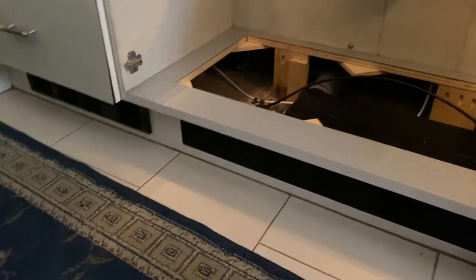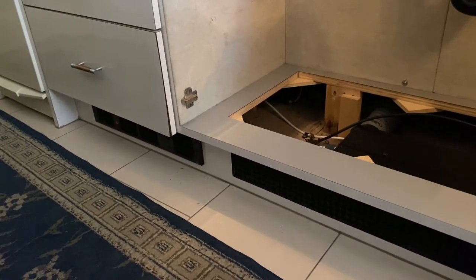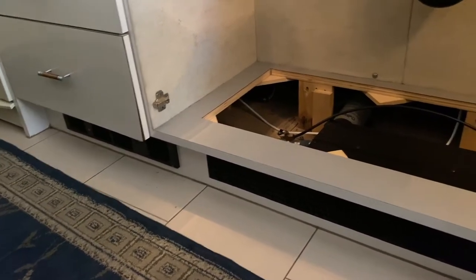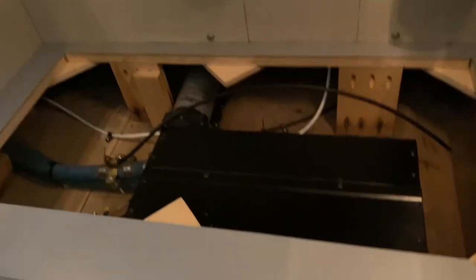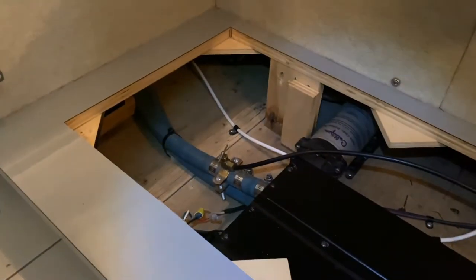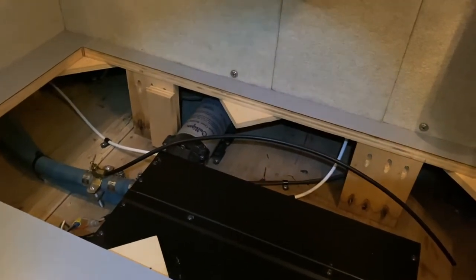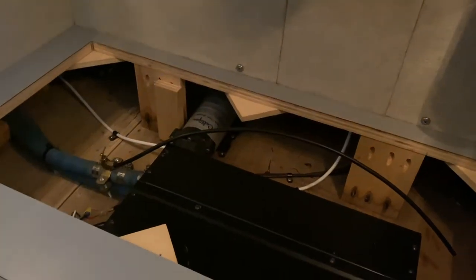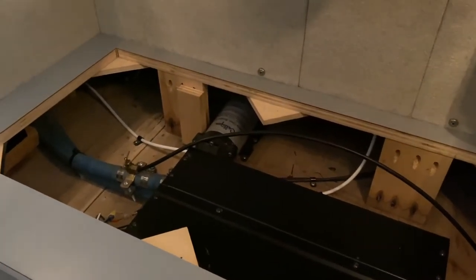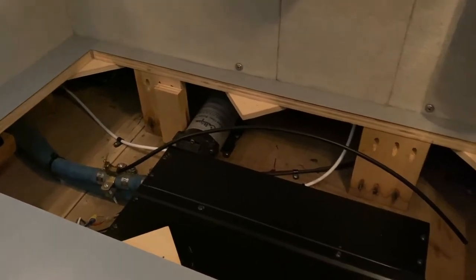The bus runs in pairs, so we're looking at the galley. To the left is the 110 Cadet heater, and underneath this removable panel is the 12-volt heater. Once again there's a valve and a hose there — this would be the second one you would bleed, going front to back, until no air and you get a steady stream of coolant coming out of that black hose.